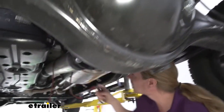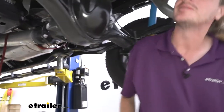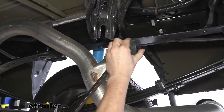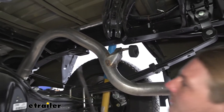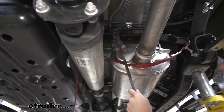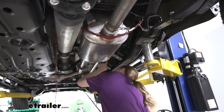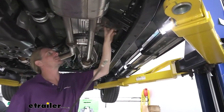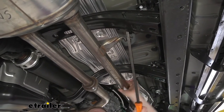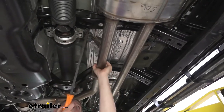We'll also need to lower down our exhaust. I've got a strap hooked on the cross member on one side, and we'll hook it over on the other side to create a cradle at the bottom to catch our exhaust so it doesn't fall too far. Here at the back we've got a hanger — we're going to use our pry bar to pry that off and let it hang. Then we go towards the front — there's another hanger right behind our muffler, and one a little further forward with one on each side. If you're having a difficult time, you can use a little spray lubricant to help ease the hangers to slide off better.